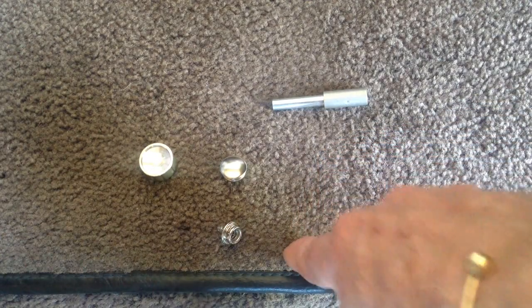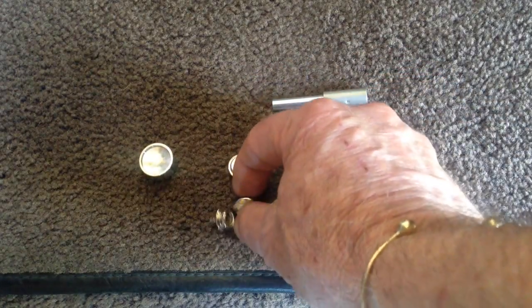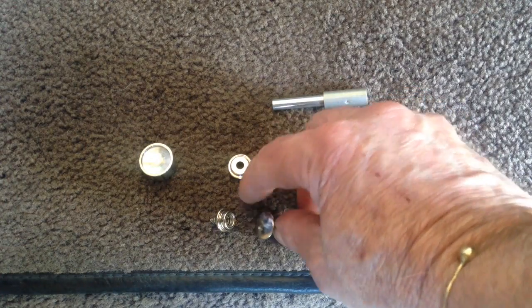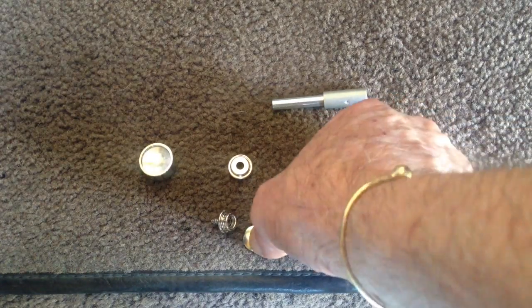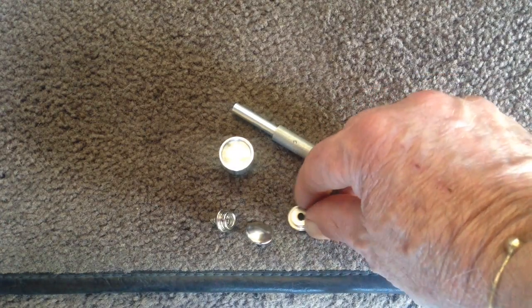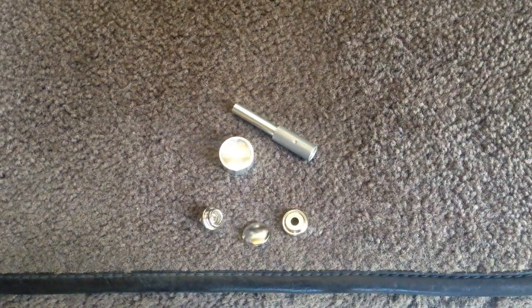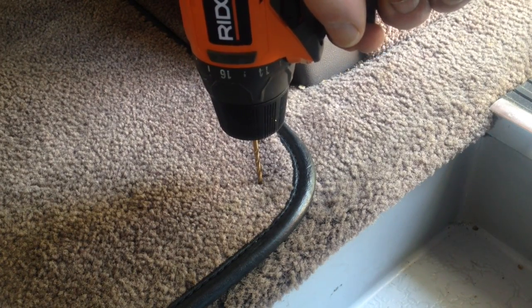Once I've done that, I still have the drill bit going through the carpet. Now I can take the pin head that has this little collar on it and shove that collar through the hole made by the drill bit. Go around the other side, put the cap on, and use the tools to crimp that collar down over the snap — giving a finished top of the snap in perfect alignment with the snap going through the floorboard.